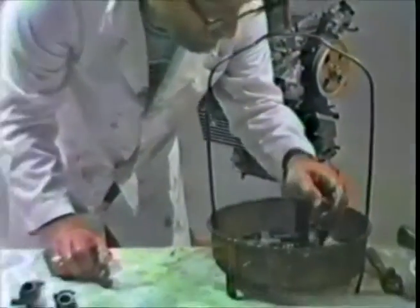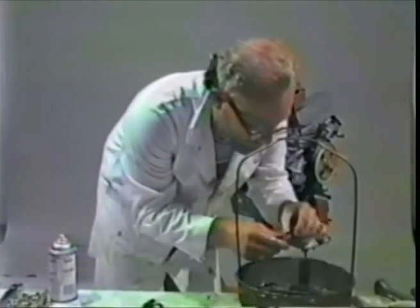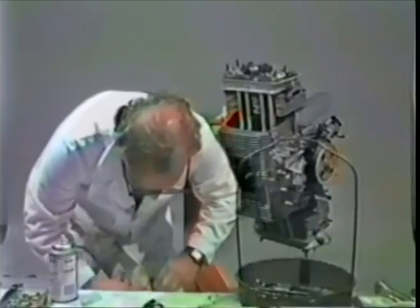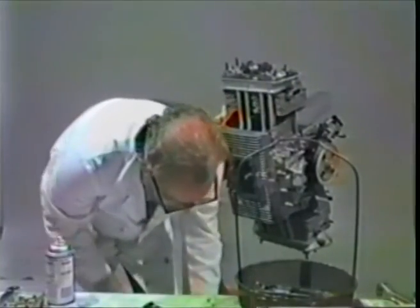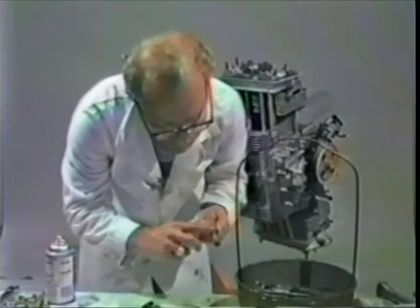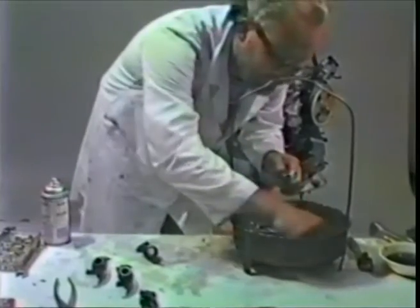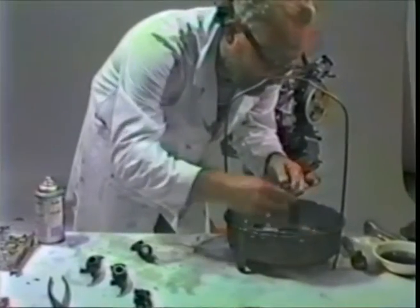Go to the better of the 2 short exhaust rockers. This one here is pretty good. Get out the best of the short rocker shafts. That one there is pretty good. Clean it off. Now if there are score marks on it, we're going to rotate it so a new virgin area is going to be used as the bearing surface. Again, the arrangement is washer, spring, washer. These are shims actually. Secret sauce. Short rocker with the adjustment end towards you.